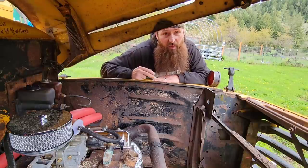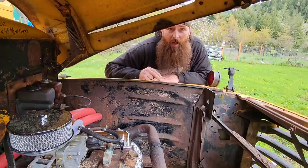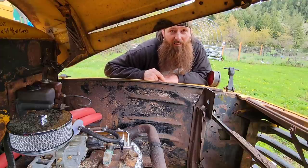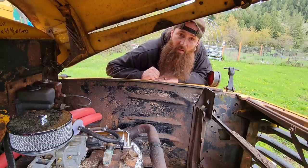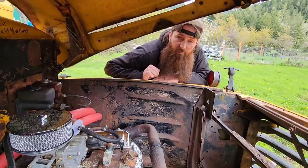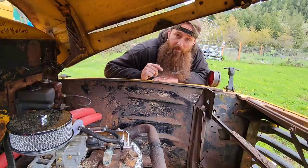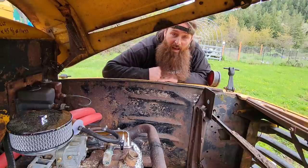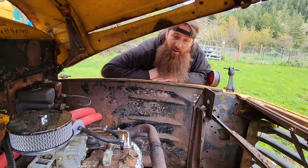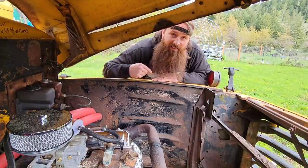This video is pretty much round two to me getting these old rusty exhaust bolts off. In the last video, I attempted to get them off — I knew I didn't have the right tools and you guys roasted me in the comments. But I had to start somewhere and give it a try. I've been lucky in the past to just put a wrench on an exhaust bolt and have it come loose, but not these ones. So I did pick up a proper oxyacetylene torch and tanks. With that proper torch setup, we're going to be able to get these bolts red hot and they should be able to come off. I also picked up an impact gun and we're going to work at these and get these exhaust bolts off.